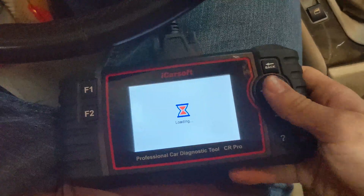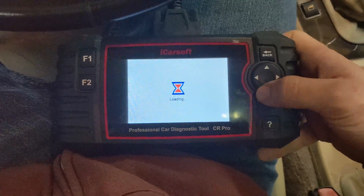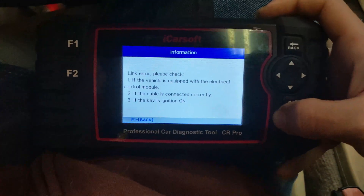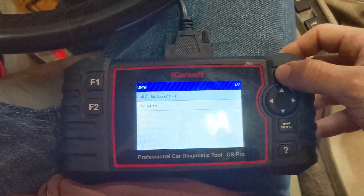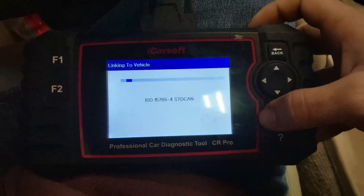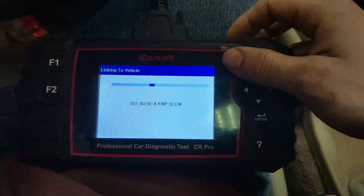Let's go inside the car and I'll show you first how this car scans without our modified adapter. On the scanner I'll try the diagnostics menu — this is what would normally allow us to access all the modules, perform resets of oil maintenance intervals, and so on. But it says it's not connected correctly, because we don't have the bypass connector in. The scanner does have a generic OBD engine checker though, so let's run that — we should be able to see generic DME codes thanks to universal OBD2 compliance that started in 1995.